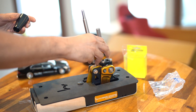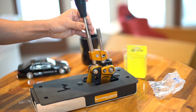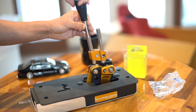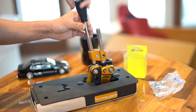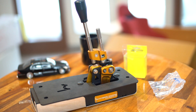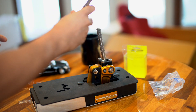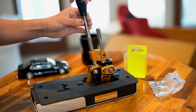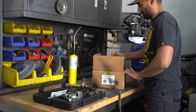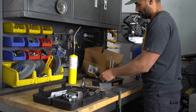This is a no-cut shifter from Hybrid Racing. I ordered it because I didn't want to chop up the interior and I wanted an inconspicuous look. It did need some tweaking — the springs were really loud, so I did some research on how to silence coil springs. I ended up sticking foam in the center of them and putting heat shrink tube around the outside, and it shut them right up. I looked up extension spring silencing.